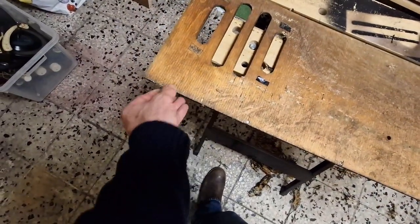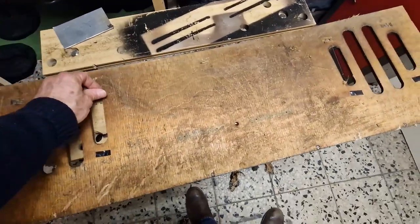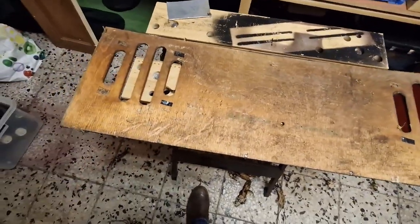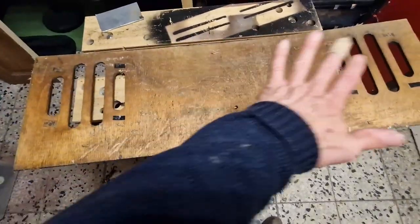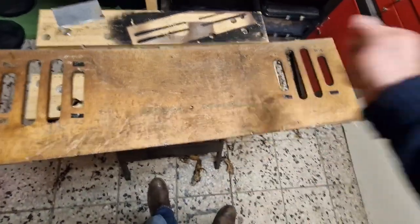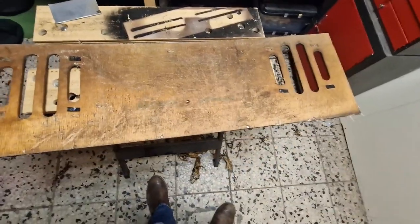The old glue's all gone. There are a couple of little pieces on the corners that need to be picked off and made sure they're 100% clear, because it sits in a channel in the gram's cabinet — and obviously with the new cloth on, if it's too thick, it won't go back in. So what I'm going to do now is get the new cloth, cut it roughly to size. With speaker cloth you want to get it laid as accurately as possible, so I like to have quite a bit of spare over the edges so I can trim it and make it look neat. I use a spray glue — contact adhesive, like carpet glue — so I can spray it on and get a really nice thick covering.